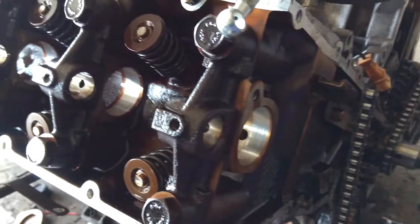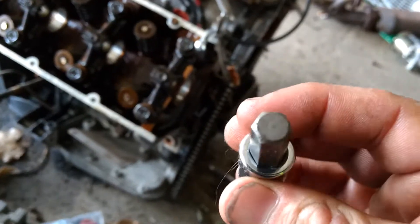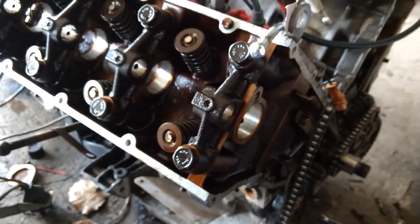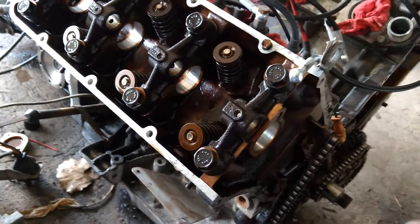There's a little key here that kind of holds the cam in place, as you can see. The cam sprocket is a 10-millimeter hex bolt. So once you take that screw out — which I believe was a 10 — you take that off and kind of just wiggle it out. Just be very careful not to bend or damage anything. Don't force anything. That is the one thing I'm learning very carefully with this engine — there is a way to not have to force it.